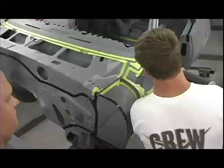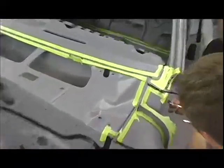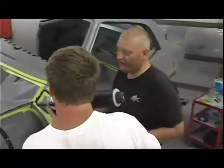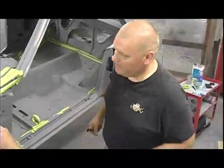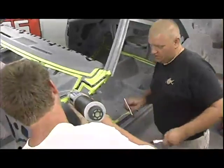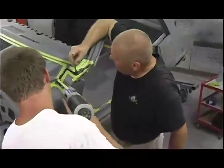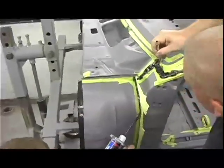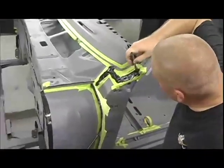Once the trunk floor was finished and the metal work was done on the bottom side of the car, it was seam sealing time. The body of the 69 Firebird has an Eastwood epoxy primer sprayed on the bottom side, and then a whole maze of tape to mark off the areas where the seam sealer is not going to be. We're using a 3M heavy bodied seam sealer, applied with a pneumatic gun that Tom's playing with.